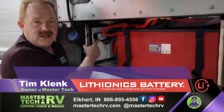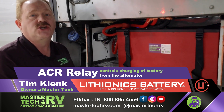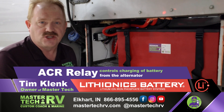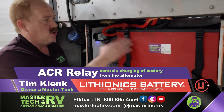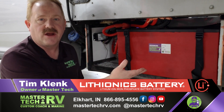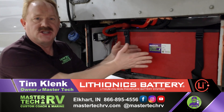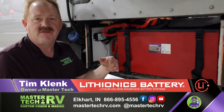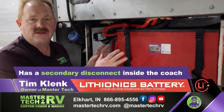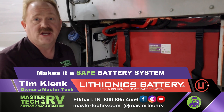This is an ACR relay — a charge controller that controls the charging of the battery from the alternator of the motor on the front of this vehicle. It is also under the UL certification. It has a disconnect breaker on the inside of the coach, and if the battery needs to shut off and the internal BMS on this battery doesn't shut off, it's got a secondary disconnect on the inside. That's what makes this battery system safe for habitual usage in a recreational vehicle.